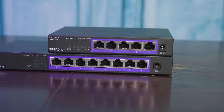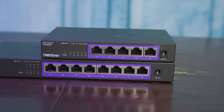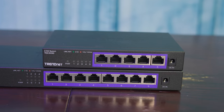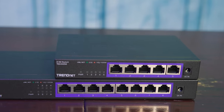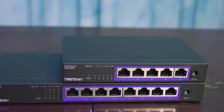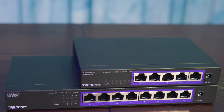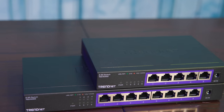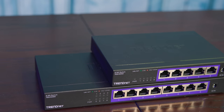Realistically, these are unmanaged switches, so they don't have all those management features. If you want to go do things like enforce certain types of quality of service, do VLANs — all those kinds of things where you might have a management GUI or CLI to edit things in the switch itself — you're not going to be doing that. These are devices that you plug in power, plug in the ports you want to connect, and you're ready to go. That makes these switches a lot simpler than some of the higher end units that we look at often on STH.